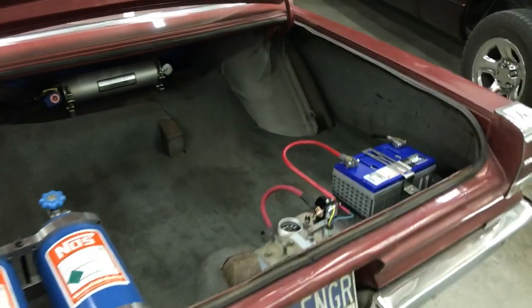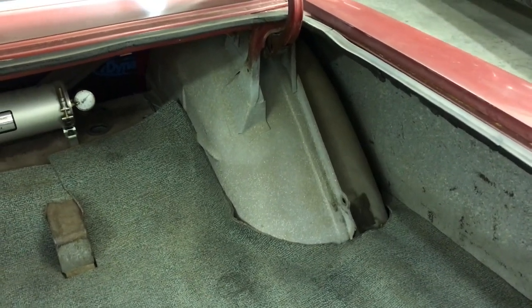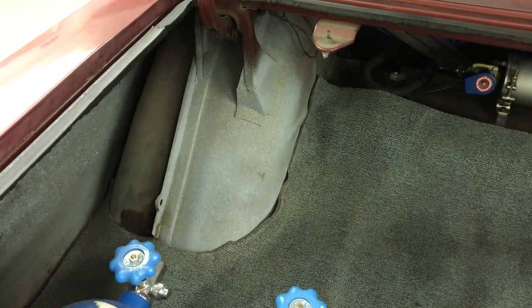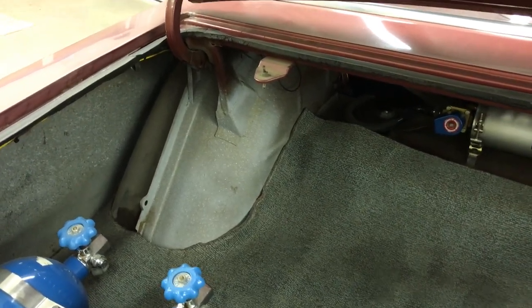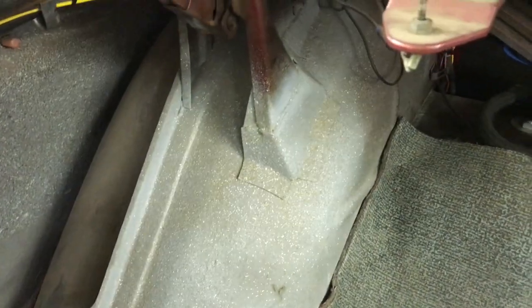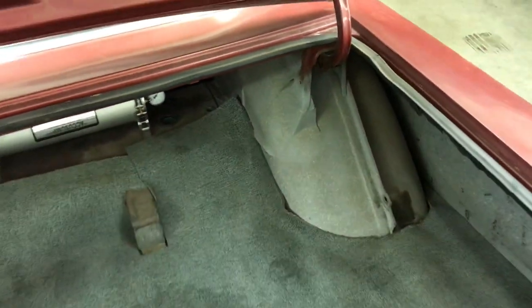The answer is pretty simple. I worked with a street rod builder a few years ago, and he took the stock wheel tubs and widened them. Everything was just welded back together, the welds ground smooth, and then shot with a factory-appearing trunk paint. If I zoom in here, you can see there's a little bit of a weld bead on the trunk support — and that's really the only clue that the tubs have been split and widened.